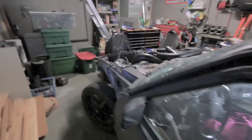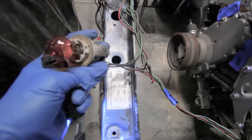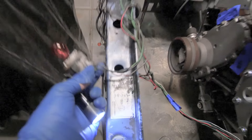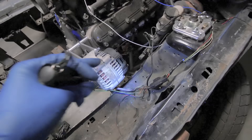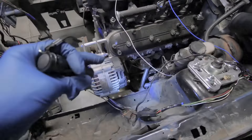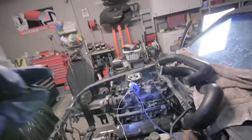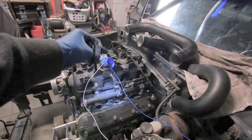Let me go show you the front and the front light harness. A lot of these connectors - this one had some bare wire and then it started breaking right there, so I might just throw a whole new front harness on, or I'm going to replace that connector and replace whatever light sockets I need to. This doesn't need to be loomed yet - I still have to connect my alternator, so that's probably going to be something I do next. I just got to order up the plug for it. These are for the wiper motor. One of these is for my oil pressure sender and one is for my water temperature sender.